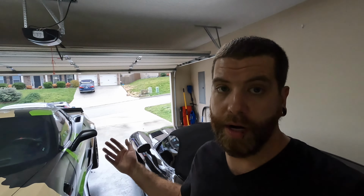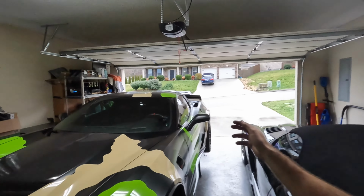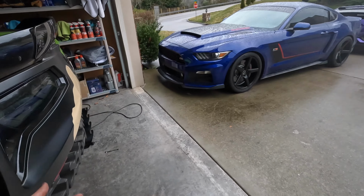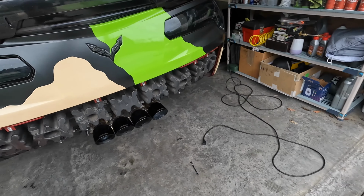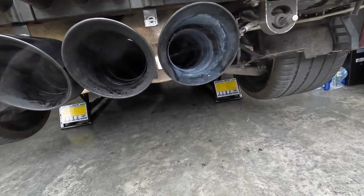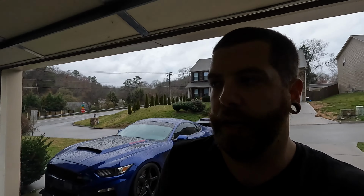And I immediately started hearing the rattle. And now it was still at about 120 degrees. The exhaust is definitely still warm. I left it on for a minute or two to let the exhaust heat up. Ignore all this white stuff, I had sprayed WD-40 in here in case it'll burn off, because I was trying to clean the inside. I was worried that there was a rock or a small piece of debris in the actual hinge of the valve that was causing the rattle. So I had soaked it in WD-40, but it was still rattling.